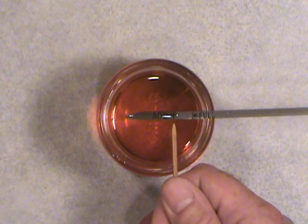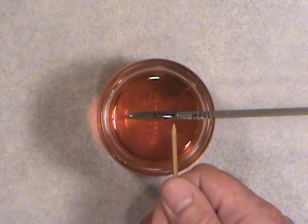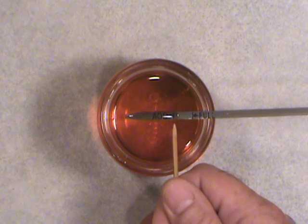I've used three different major brands of oils over the years. Where I live, it very seldom goes over 100 degrees Fahrenheit on a hot summer day, and in winter it does dip below freezing just by a few degrees. So it works good for me. I use 10W40. 10W stands for the winter weight. It'll start easy enough, because we never get that cold. So if you're going 40 below, you're going to have to go to a 5 weight something, 5W30 or something. But I like the old school stuff myself.